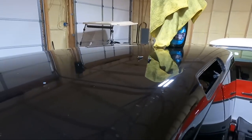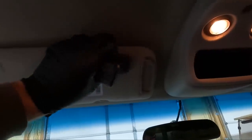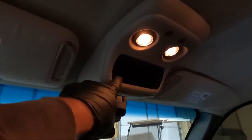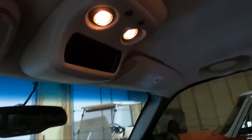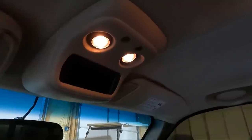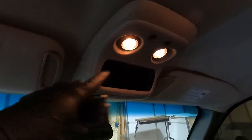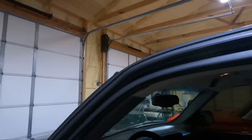I've got the screw sitting on top, the roof is trashed. Anyway, I've got a bunch of garage door openers here — I'm going to take those off. I think we'll start in the center with a Phillips screw here, and these are like T-15s or T-10s. We'll work our way back and pull the pillars out. My hope is I can get it out to my upholstery guy and he can recover it. At the same time we'll give all these parts a good cleanup and replace all these old halogen bulbs — there's a bunch of bugs in there. We'll replace them with new LEDs, which I'll list in the description. Let's get set up on the tripod and get started.